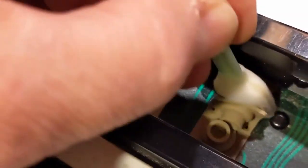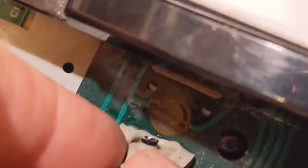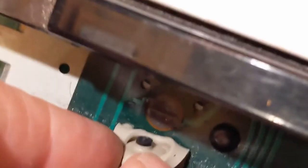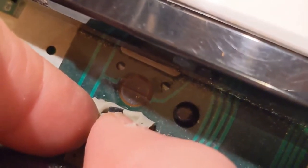If you've never cleaned one of these before, it's really straightforward. It's your swab. You lift up the little rubber piece and you clean the switch underneath it. It's not mechanical per se — what you've got underneath is two sets of interlocking contacts. This little black part, which is pushed down when you press the key, makes a complete circuit across those interlocking contacts firing the key. So I'm going to clean the black part, wipe off the contacts themselves, and take a closer look at them. We'll be trying this out momentarily.